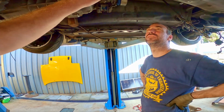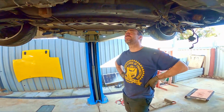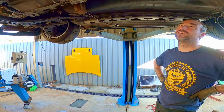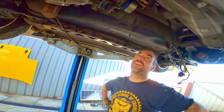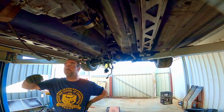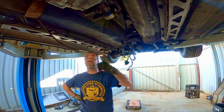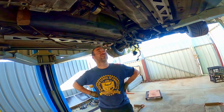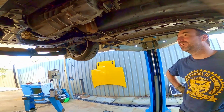You're still planning to run gearbox mounts across from these frame rail braces, hey? Yeah, it'd be real easy for us to go across the car. Just like there and just put plates on the other side. I'm not against that idea. And we keep it above these as well. All we would have to do is put big plates there and tack them on the inside of the cup. That's the easiest way around it. Yep, and honestly, by far, that's going to get the job done.